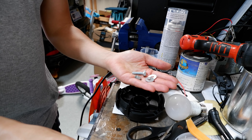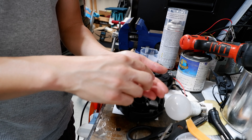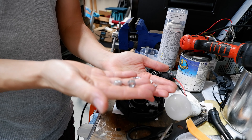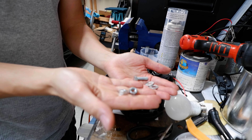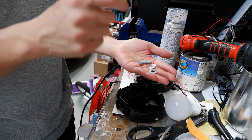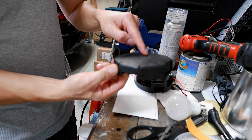What I got here is a 5/16-inch diameter bolt, two washers, and two nuts — one is going to be the one that holds it on and one's going to be the lock nut in case this thing spins and comes loose. I'm going to drill the hole right through the cap and just put it through.